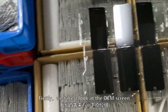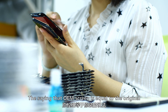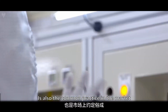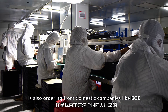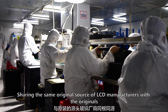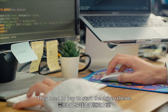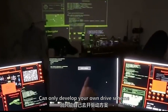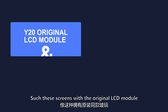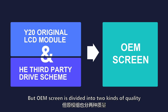First, let's look at the OEM screen. If your supplier claims their screens are original, they are most likely OEM screens. The saying that OEM equals original is a common market practice based on certain facts: OEM screens, just like originals, are ordered from domestic companies like BOE, sharing the same original LCD manufacturers. The difference is that since Vivo doesn't release its own underlying code, the factory must pay to develop its own drive scheme. Screens using the original LCD module but with a self-developed drive scheme are called OEM screens.